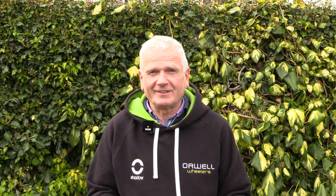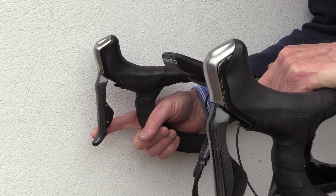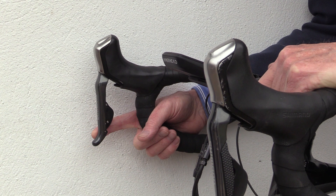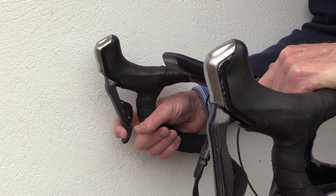Not that you will do it yourself, but you take them to a shop. The first big and very significant indicator is lever travel. When you pull your brakes you should find them engaging almost immediately. If the lever travels back to nearly touching the handlebars, that would be a very significant indicator that you need to do something.